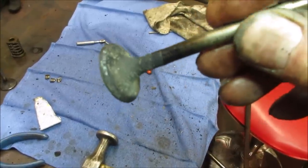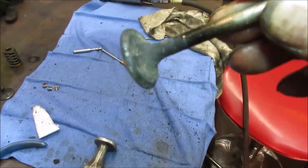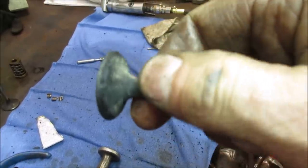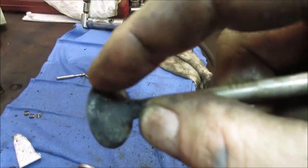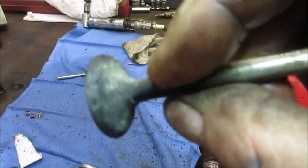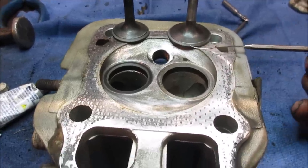Yeah, that's the exhaust valve. That one's even worse. Definitely see how that wasn't closing up. Especially right there, wherever that high side of clump is. Where'd it go? Yeah, that right there. Another one there. It's all over. Yeah, they cleaned up nicely too. Both those seats look fairly decent.